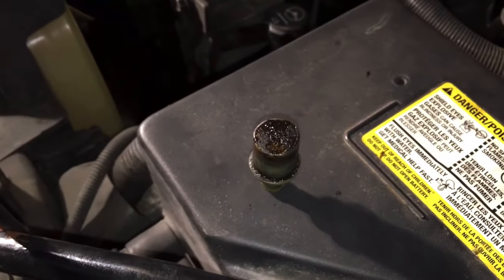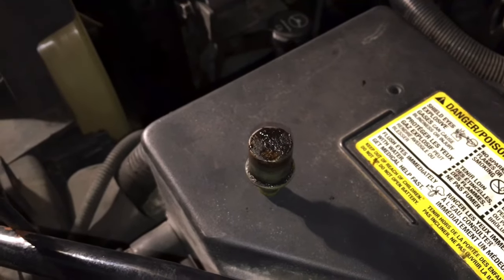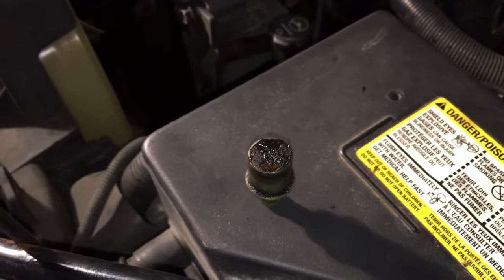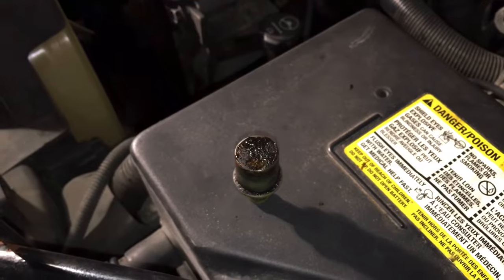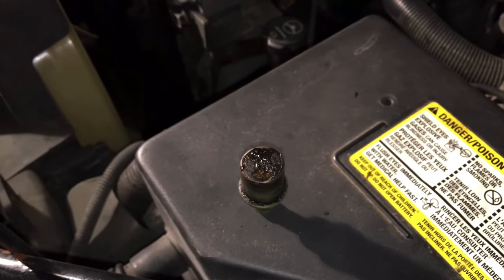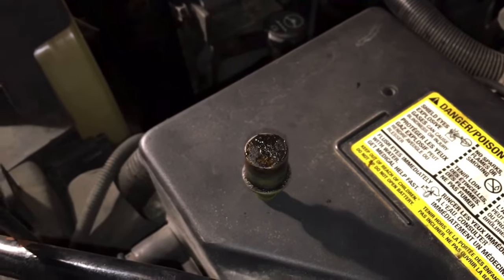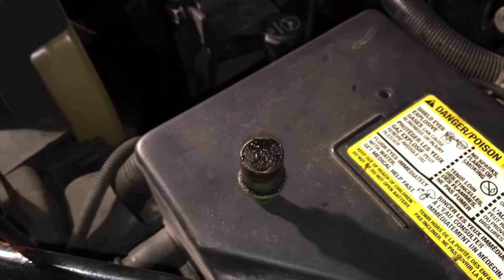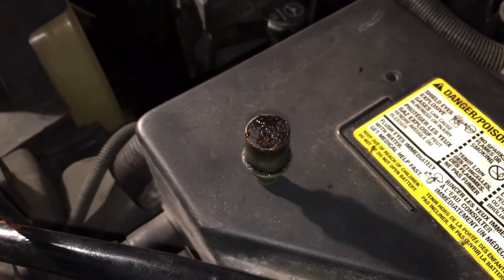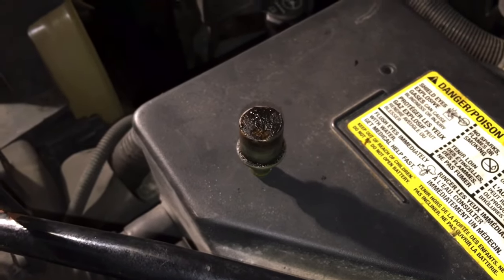In the case of this one here, the open valve is completely blocked up. Some other symptoms of a stuck-closed PCV valve system include increased engine pressure, which can lead to oil leaking from the vehicle due to high pressure. So check underneath the car — sometimes you'll hear a whistling or moaning noise as well. Engine surges and problems with the mass airflow sensor can also be caused by this, and sometimes P0171 or P0174 trouble codes can be an indication to check your PCV valve first, as that's a very inexpensive and quick inspection and even repair.